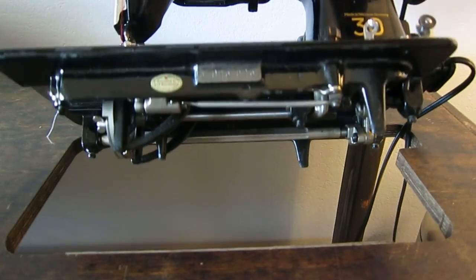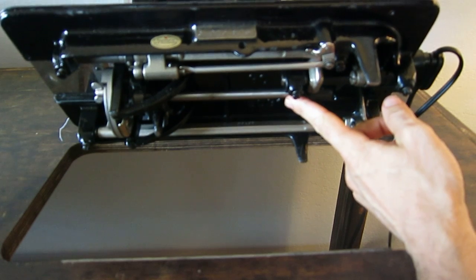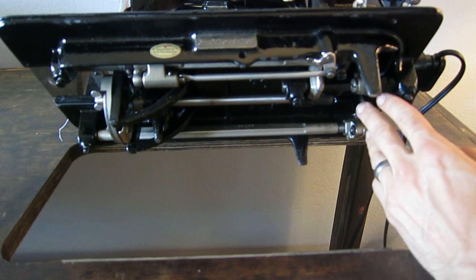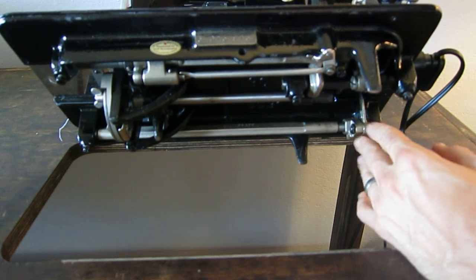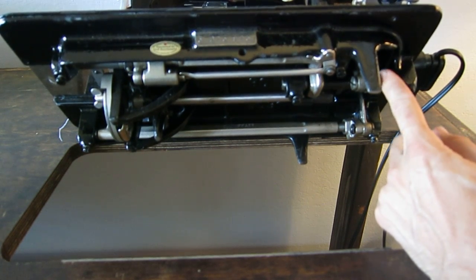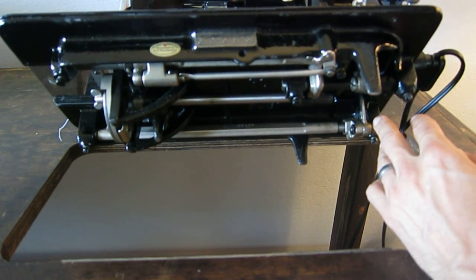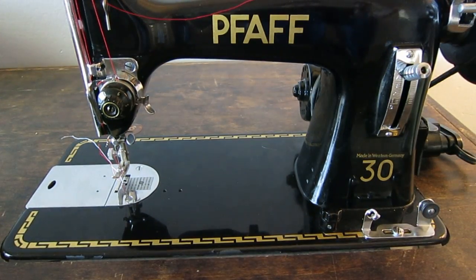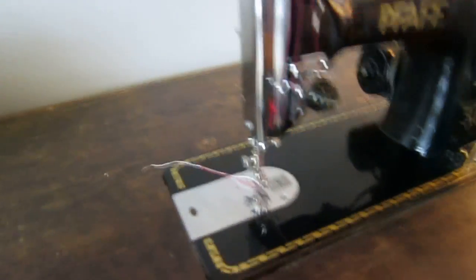The biggest way this is superior to the 130 is that the Achilles heel of the 130 is it uses a cleated nylon belt to drive the lower shaft. The problem is those are made out of nylon and over time — you're talking a 56-year-old machine — those belts break, and once they break the machine is done. I think there's one guy selling replacement belts but I don't know about the quality. This Pfaff 30 is fully steel — everything in here is steel with the exception of the handwheel and the tension knob.